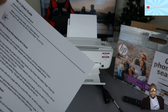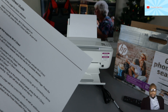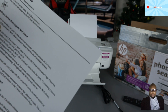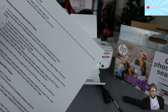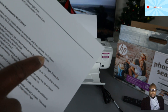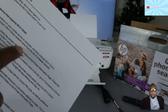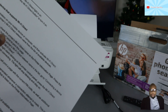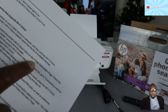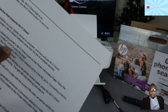If the light is off, press the Wi-Fi Direct button to turn it on. For connecting a device that supports Wi-Fi Direct: turn on wireless on your mobile device or computer, then activate Wi-Fi Direct, and select the printer's Wi-Fi Direct name from the list of available networks. You can check the printer's Wi-Fi Direct name on the printer information page — press the information button once to print this page.